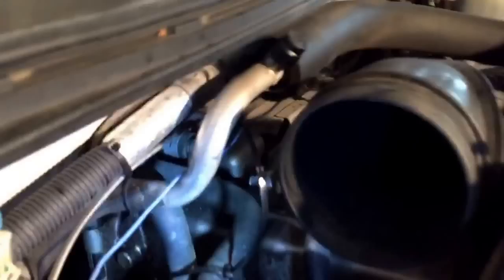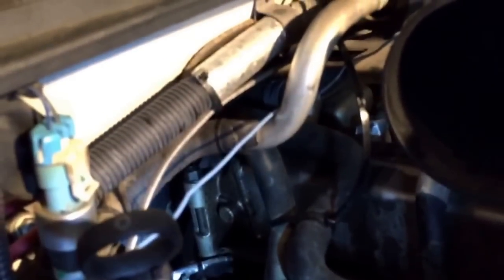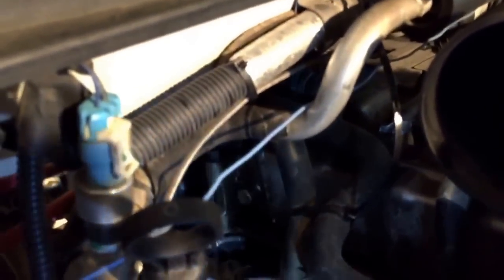So you guys that want to do this, I highly recommend you use a ratchet strap. I mean, it worked perfectly. You ain't got to fight it, you ain't got to bust your knuckles up. You just tie it on the top of that wrench, put the wrench on the bolt, and go to ratchet. And you can see where I tied it up right there on the end of that corner mount right there. I'll show you.